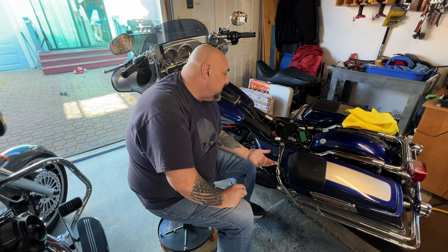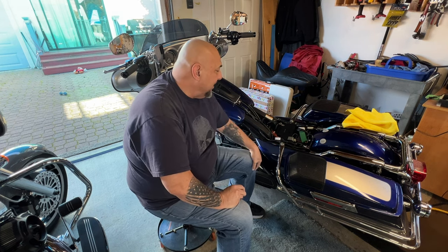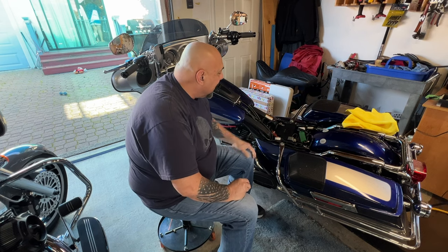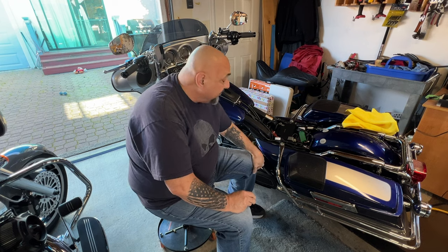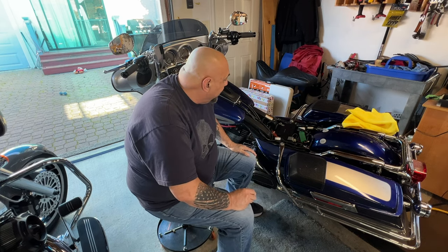I also wanted to mention: when you buy a battery, they give you short screws because they're made for just one cable — one small ground. But when you put a stereo, extra lights, and other stuff on your bike and run it directly to the battery, it gets thicker and thicker. So there are sometimes longer screws provided with the battery. Sometimes the little bolt sits on the bottom and doesn't really reach. What you can do is put a little piece of cardboard or tape to raise it up, so that when you go through all the eyes on the cables and start turning the screw, the nut doesn't spin inside the post because it's shaped to fit. So those are just some small tips I wanted to share.